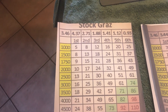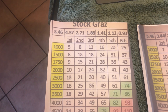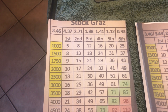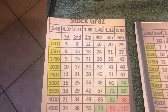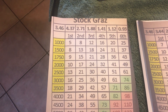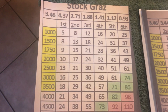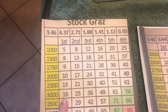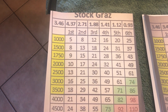This is the stock Graziano gear ratio. A Graziano is meant for an overhead cam engine as provided in a Lamborghini or an Audi — those engines rev to about 8,000 RPM and deliver their torque higher in the rev band. An LT4 engine delivers 650 foot-pounds of torque at about 3,000 RPM, so the way you generate power in a pushrod Chevy is very different. Typically I like to accelerate on the street to about 3,000 RPM, and with the stock Graziano you're only doing about 16 miles an hour — so first gear just becomes not all that useful.